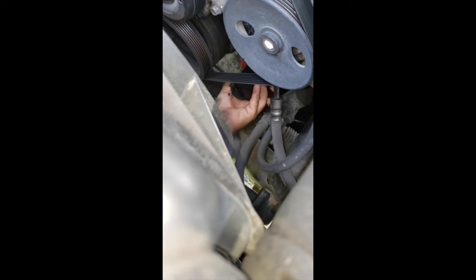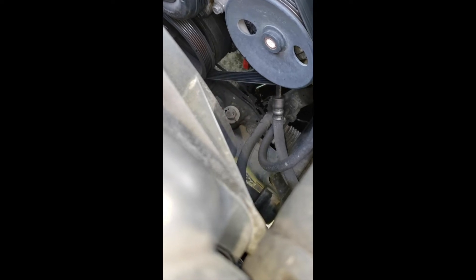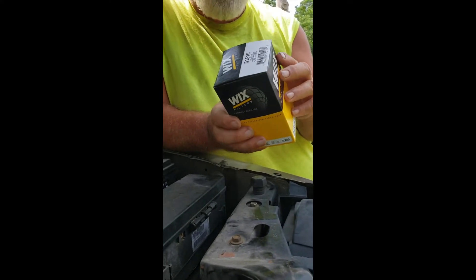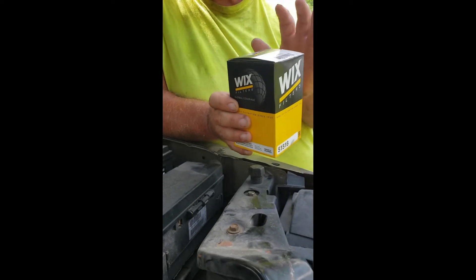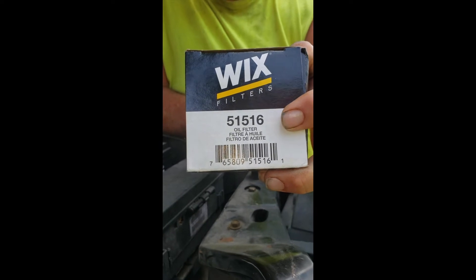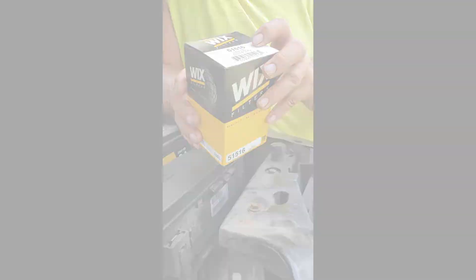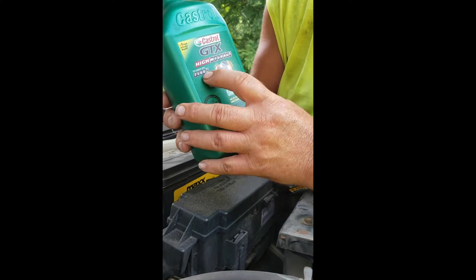You can't see me, but you can hear me. Here's the oil filter right here. I've already broken it loose, so you just take it and turn it. It's kind of tough to get loose. The oil will come spilling out, so just turn it real slow with your fingers. You'll feel when it comes off the block bolt, and you just carefully turn it over and it'll drop right out of your hand.